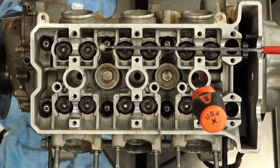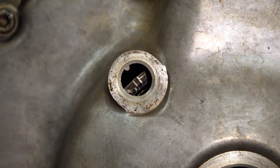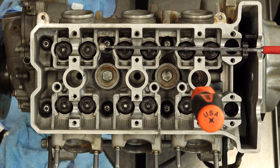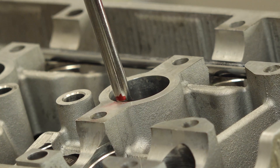What we're looking for here is top dead center for cylinder number three. To find that, you've got these two marks that are parallel to each other — bring it around and you want to be right in between those two marks. You can verify it by just putting a screwdriver into spark plug number three, and you can see where it reaches the top of the stroke. So that verifies that it is indeed at top dead center.